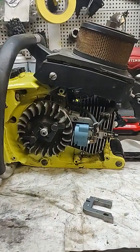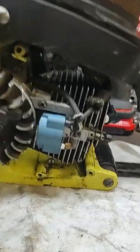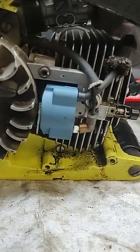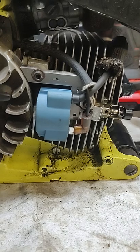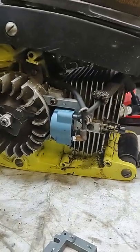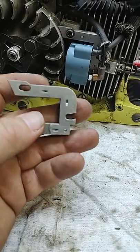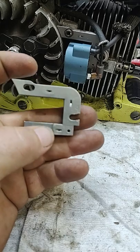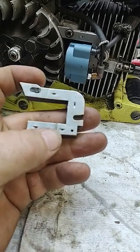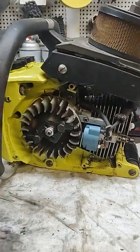This is the Pioneer P60 and I ordered a brand new aftermarket Homelite XL12 Super XL coil, and that's what works on it. You got to slot the back one out a little — it barely catches — and then you got to slot the front one out a good bit, but it works. It makes spark and runs fine.